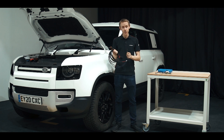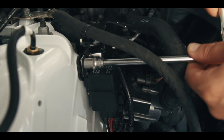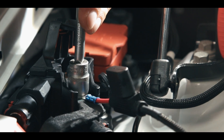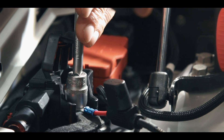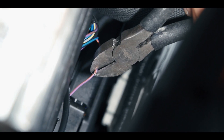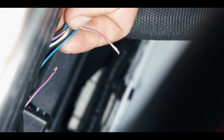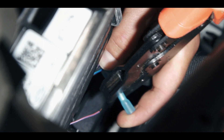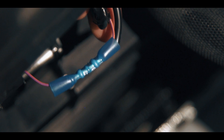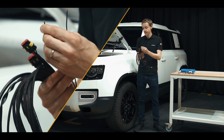To use this loom on the Defender, simply find the battery and connect the relay directly to the 12-volt battery. You also need to connect the ground. You then splice the purple wire to the back of the headlamp high beam — this is when you've confirmed 12 volts at the headlamp. Connecting the purple wire gives the signal to the relay that the high beams are on. For the position light, splice the green wire directly to the back of the position light on the vehicle.